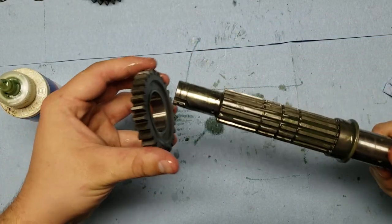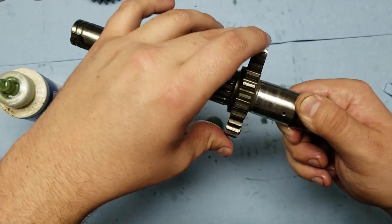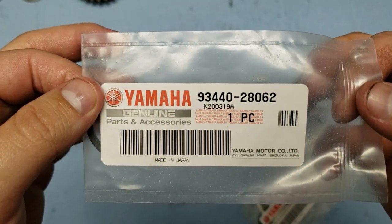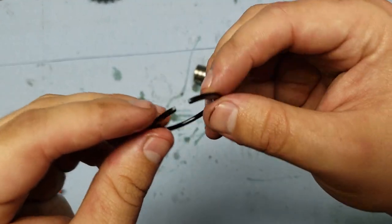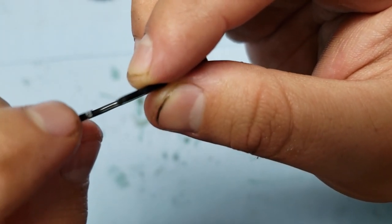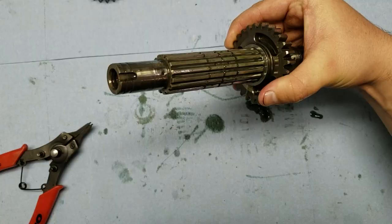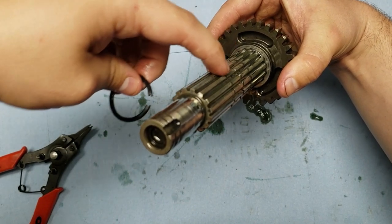Now for the fourth wheel gear — as I was saying, as this thing rotates, it's going to move the collar with it, so it does not matter where that collar sits. It's going to rotate and receive the oil that it needs. Then the tooth washer. Next up is the circlip — I have three of these and this is the OEM part number if you need it for reference. Now before I install the snap ring, there is a difference between the snap rings. There is a little bit of a shaving on both ends — one side's a sharp end and one side's a dull end. You need to install the snap ring with the sharp end away from the tooth washer that you just put on. Also, whenever you're installing it on the axle, you want the ends of the snap ring sitting as close as they can to the middle of the splines.